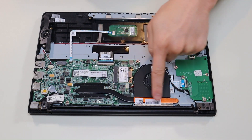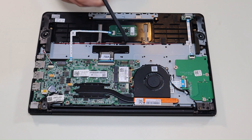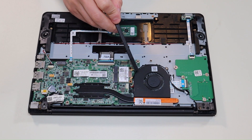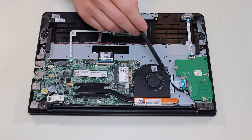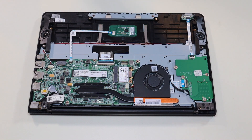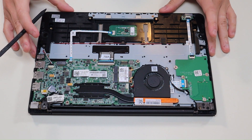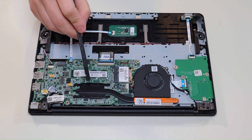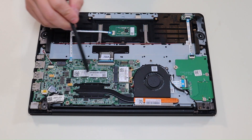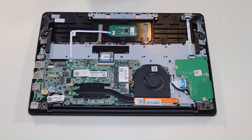This is your fan and heat sink assembly here. Your fan is held down by a single screw, and the heat sink assembly is held down by these four screws over your CPU, which is pretty normal. Be careful when taking your fan out — the antenna wires are run through the fan, so make sure you unroute those antenna wires before you rip it off, or you could damage them. If you're in here to clean this and reapply thermal paste, I'll have a link above and also below in the description with a tutorial on how to reapply thermal paste correctly. I'm not going to take that off in this video because this computer is working fine, and if you take off your heat sink you should clean it up and reapply thermal paste once air hits that. I'll have the spec information for the heat sink and the fan below in the description and I'll try to have some replacement options in that parts link.